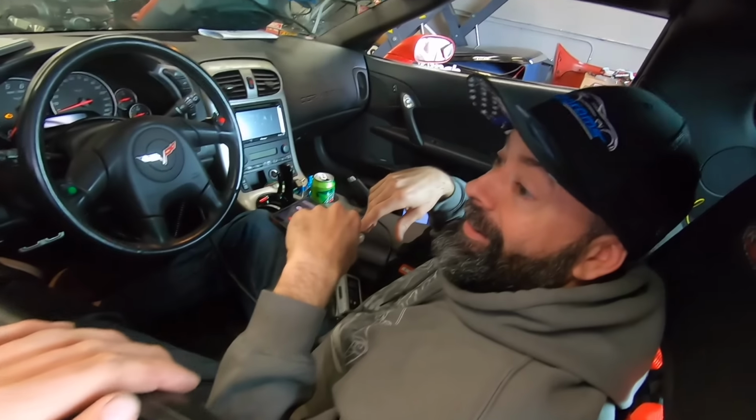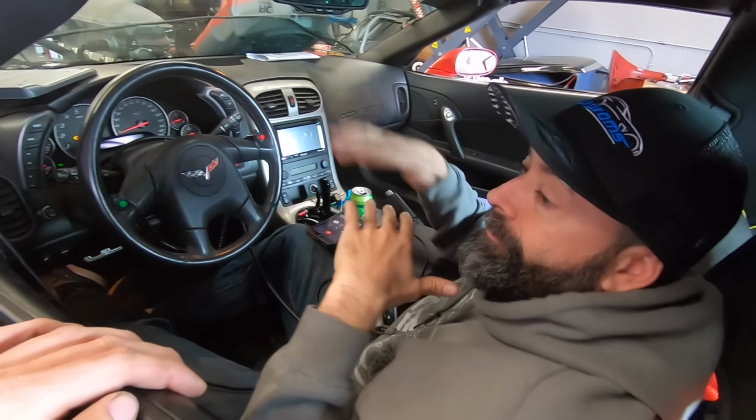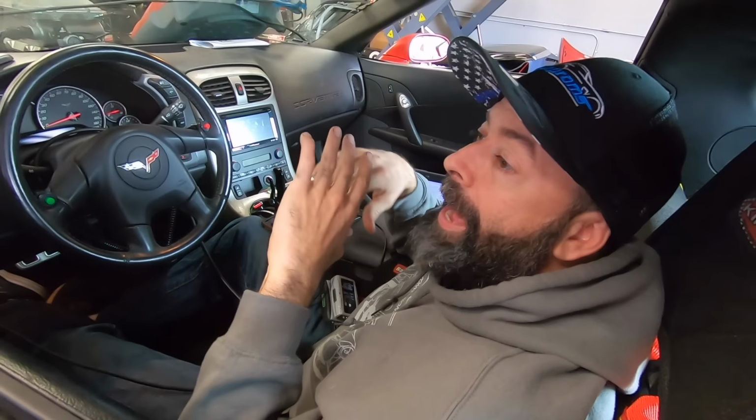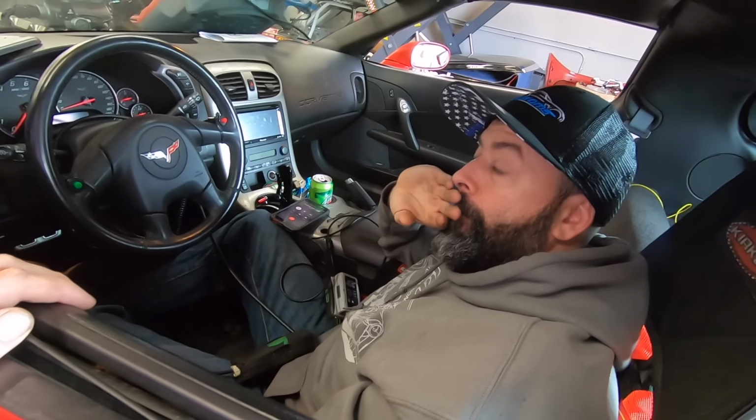That's in first gear. Yeah, man, it was off the chart rich before. It just cleaned up. Took 13% off the whole map for the fuel. Now it's on straight ethanol, and it's loving life.